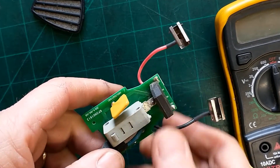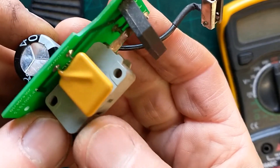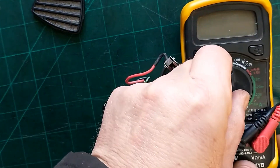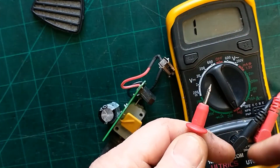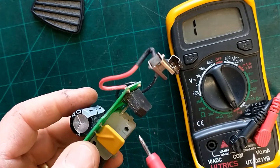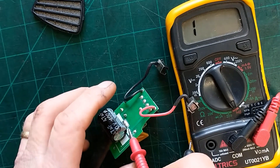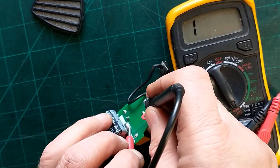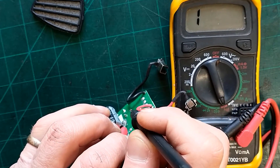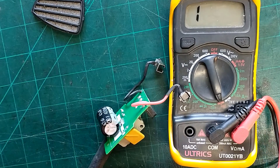So this circuit board and the switch. It sounds like it's working, so we just need to test it. All we've got is a little multimeter — I'm going to switch it onto the buzzy one, the one that makes a noise. So when I touch them together and get a contact I should have it go. I can see that one runs through and goes to that terminal there, and on that one there is probably the other side from it. So if I connect from here to here I shouldn't get anything. And if I now press that switch in on the back — I can see I've got a contact there. So that switch is fine.